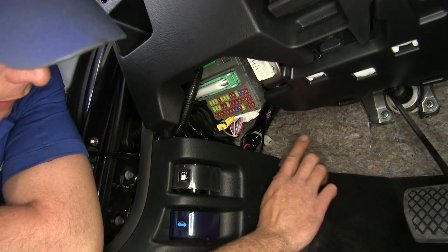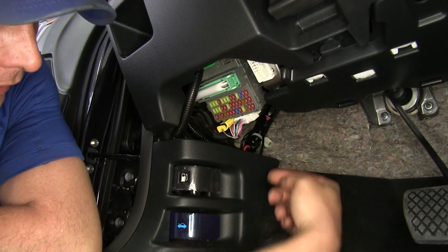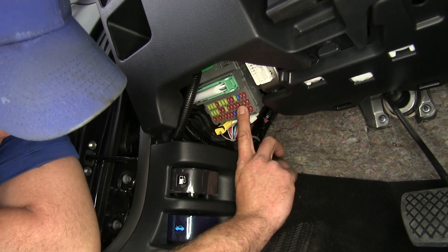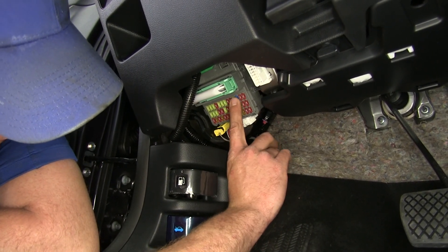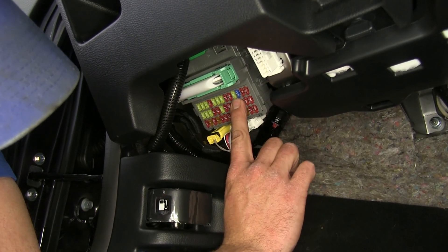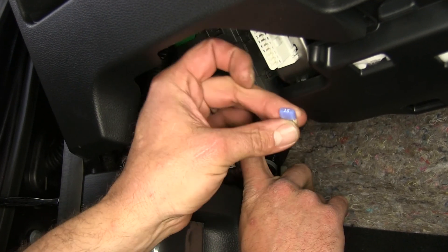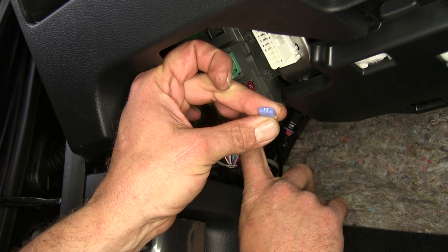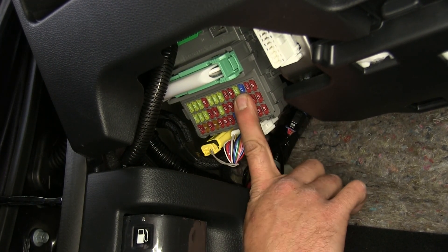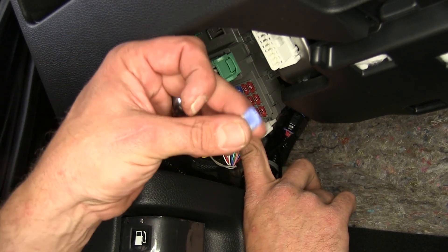The next step is to check underneath our dashboard in the driver's side floorboard. This is the outside edge of the car — your fuel release is here, hood is here, and there's a fuse box right above it. If we look in the very top row, three over: if there's not a 15-amp fuse in there already, you can put in the one that comes with the kit. This vehicle already had a hitch on it, which is likely why that fuse was already there — but definitely check it out. If you need to place one in there, it is provided with the kit.